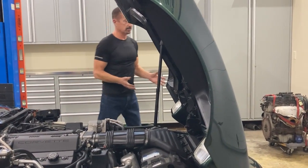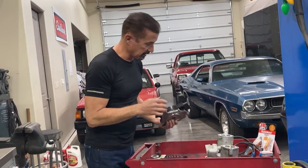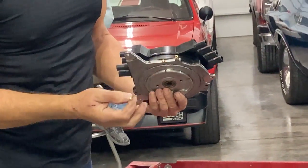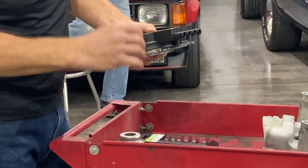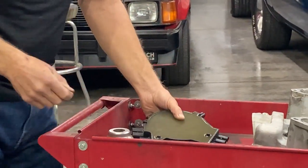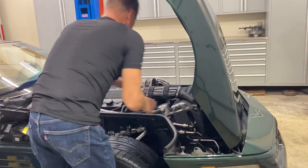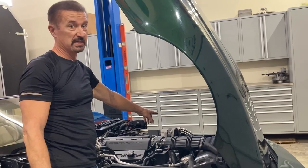That's basically what I did. I copied what GM did for Buick and Pontiac and applied it to my unvented system, so I've created a vented system that should work well. It's really not that hard — pretty simple, basic tools. The hardest thing is getting those little connectors. Also, that center hole — I just took a nail, cut the end off, and plugged it. You can use a screw or fill it with JB Weld, but we're not going to use the center one because your crank damper hub is right there. So one fitting goes off to one side and one goes off to the other. Be careful routing on that side so the hose doesn't get into the belt.